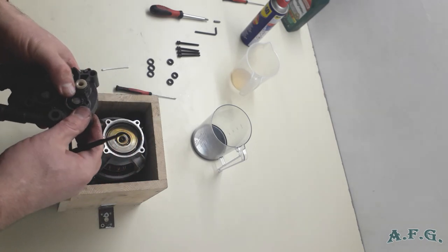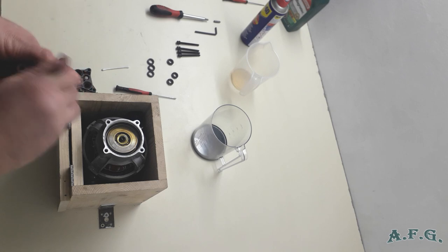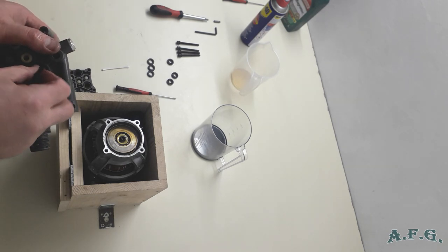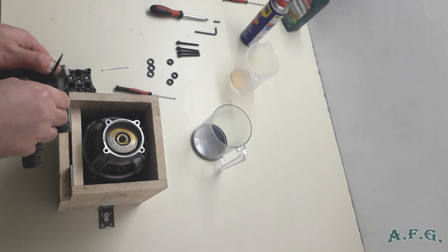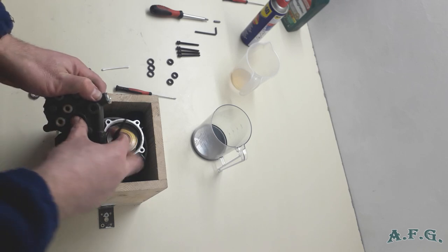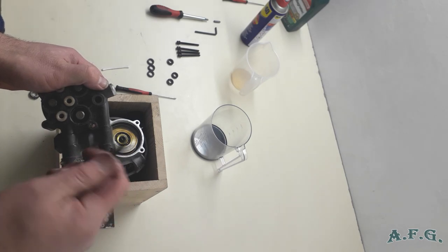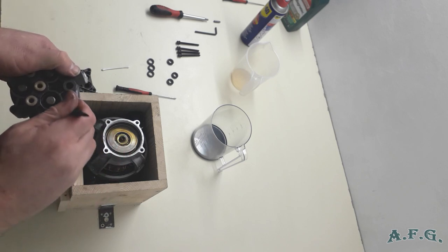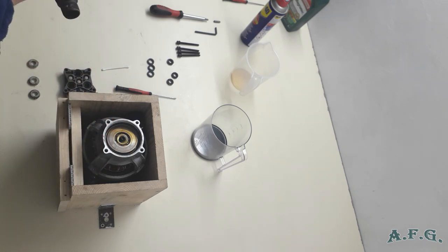It takes time, but there is no rush. Do it properly, it pays off. And the third one. As you can see, I'm trying to fit them there with the other part of the nylon pick because I know that the nylon doesn't scratch the surface either of the oil seal or of the packing, this metal packing. Okay, so I have it.